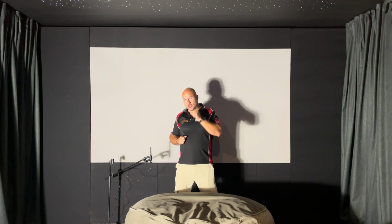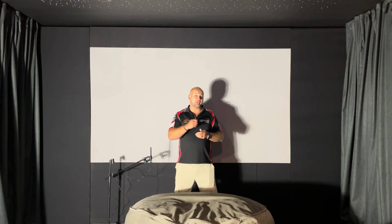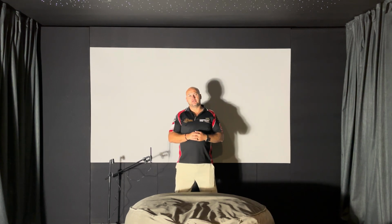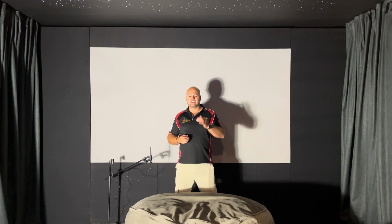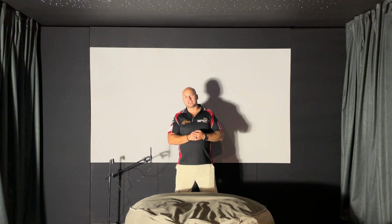If you do not, please just let Dirac do its thing. Let me explain. I thought I knew the subs, I knew the specification. I sort of know what this room is doing, but when I loaded that in, did all my Dirac calibrations, loaded my Harman curves, did the crossovers as I showed you guys, when I got to the demo late last night, the subs at the back, the ones I installed now, they were bottoming out left, right, and center.